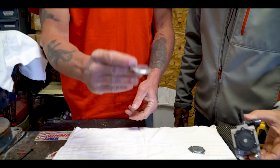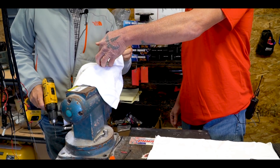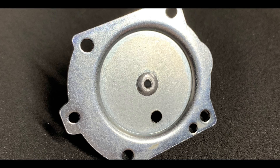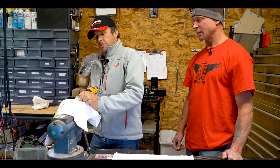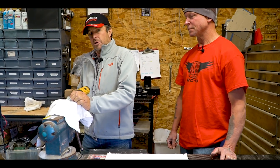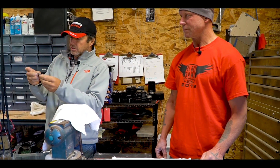Now you should just have the metering plate. The first thing we're going to do is drill another hole in here so that we have ambient outside air pressure for the metering diaphragm to work properly, in case the rivet hole gets clogged up for any reason. An eighth-inch drill bit works fine and it doesn't really matter where you put it. Always use good bits. I'm going very slow — you don't want the bit to grab and twist or bend this plate in any way, shape, or form.